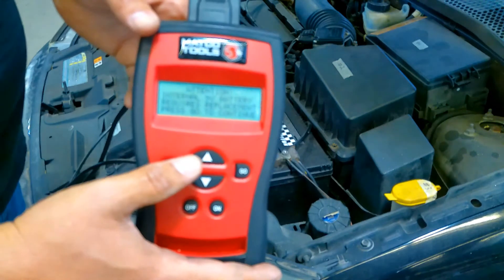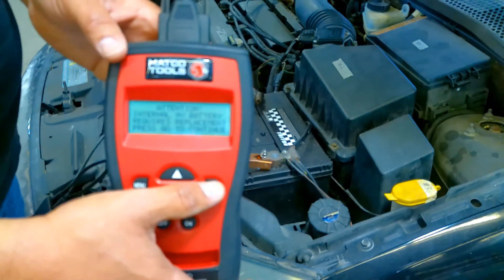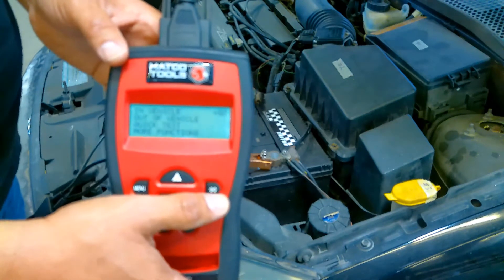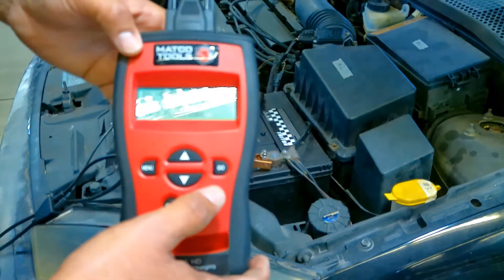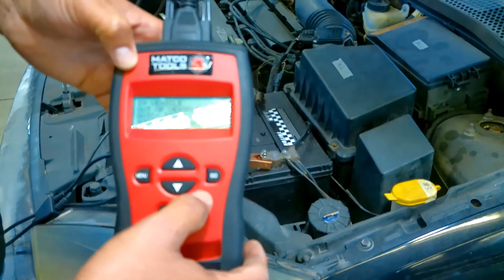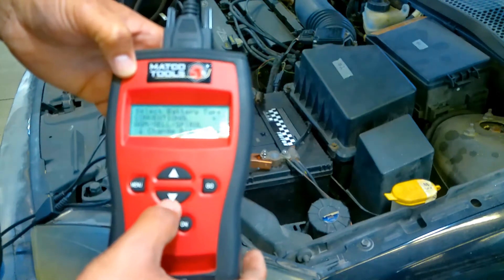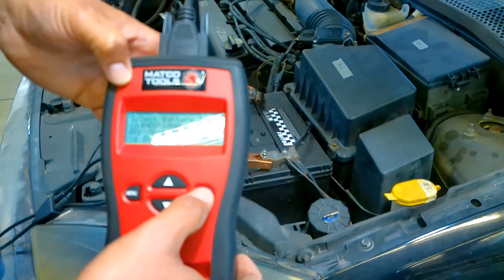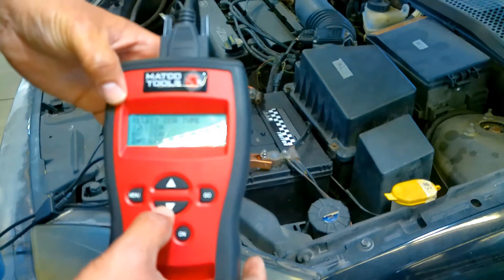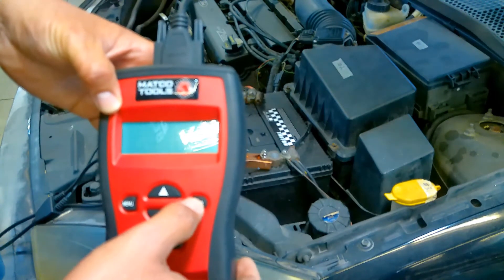There is a warning symbol telling you to put a 9-volt battery in this tester. We haven't done that yet — it's a new tester — but we're going to go ahead and hit go. It's going to walk us through the menu. We're going to jump down to quick test and hit go. It's going to ask us for the type of battery. This is a conventional battery, so we hit go. Then we have a 12-volt battery and we're going to be testing the cold cranking amps. We hit go.